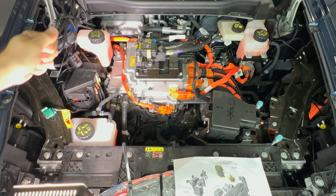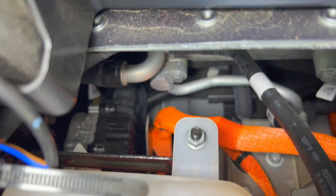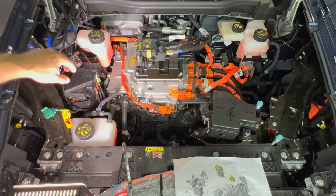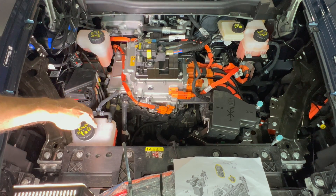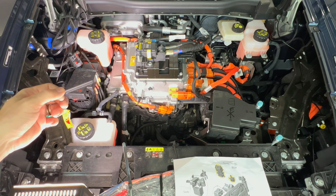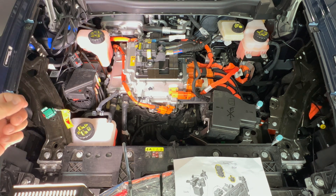For the heater or cabin tank, it's located here, but the pump for it is way down below and can't be seen from under the hood. It's only accessed from underneath the car, as are the two motor pumps. I discussed this process in my water pump recall video, which covers the recall, TSB, and what needs to be done to replace that pump.